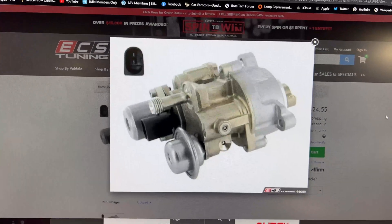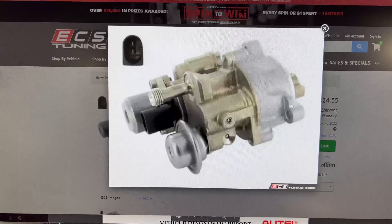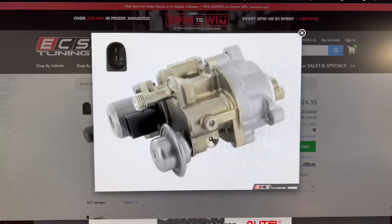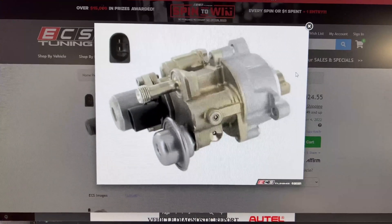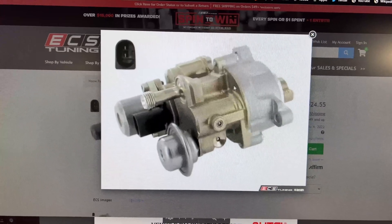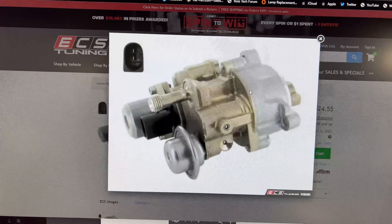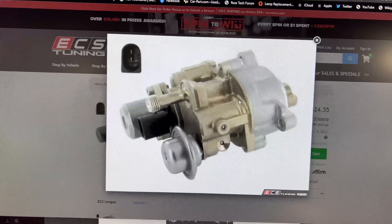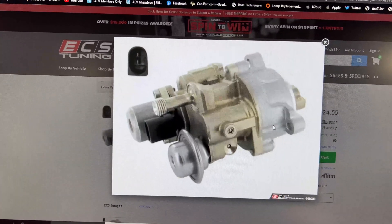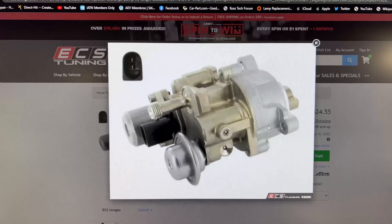The rotary pump I'm referring to is this one — this is what BMW was using on the older N54. It uses a fluid inside and a rubber seal, and when that seal gets damaged, it mixes the fluid and the pump is garbage. The test that Chris described — watching for pressure to hold — is no good on this pump design.